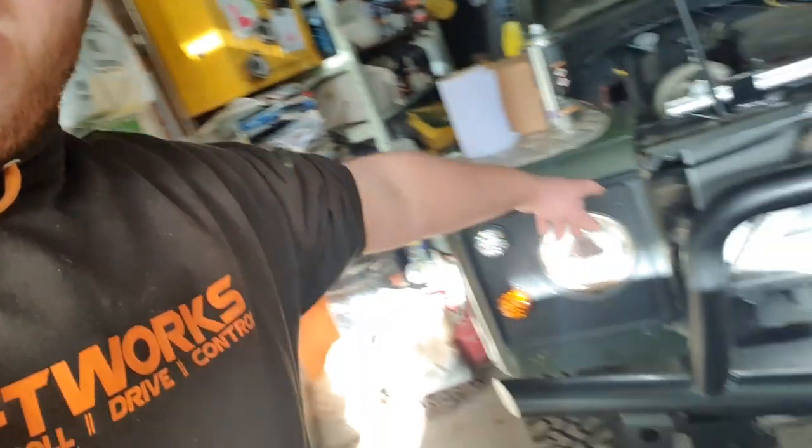What else have we got to do? Fit the alternator back up, which is down there, hidden away. It actually needs to be bolted back up again so I can put the belt on. And the final thing to do, actually, before, well, we can start it up without that. There's the oil cooler lines that need to be done before we start it.